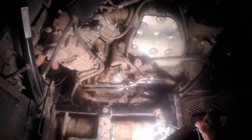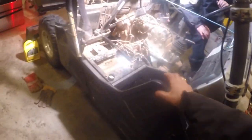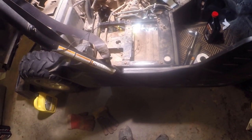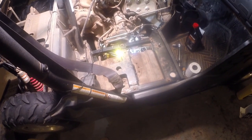I thought we had a leak around the water pump housing but it was really just residue from before we started our leak test. What I should have done is wipe the whole thing down clean first and then let it run for 10 minutes. Since we wiped it down we don't see any new leaks, so I think we're good. This is the end of the do-it-yourself stator replacement for this 2009 Rhino 700. All in all we were about a hundred bucks for the part off Amazon, 60 bucks or so for oil, filter, sealant, and other stuff - so for a couple hundred bucks we got this thing rolling and charging again. If you like my do-it-yourself videos please subscribe to my channel.